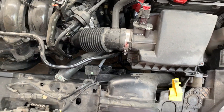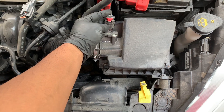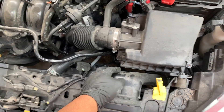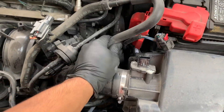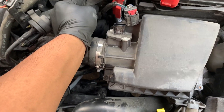So replacing the radiator, the first thing we're going to do is remove the air cleaner box. Go ahead and unplug this, pull this red tab up, and push down to remove the mass air flow sensor. Then with either a Phillips head, flathead, or number seven socket, go ahead and remove the hose clamp here and pull it off the throttle body, as well as pull this off here.